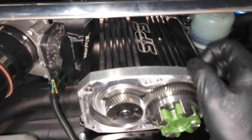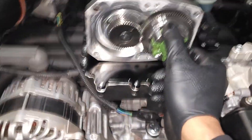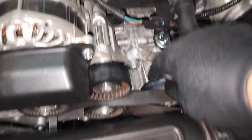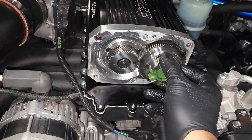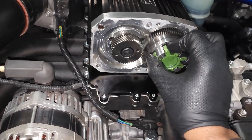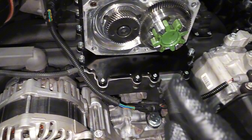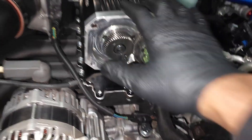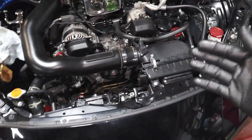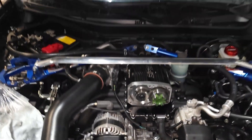Now we've got the rotor holding in — a very nice snug fit. The rotors are in there. This is the drive: your belt, which is here, is going to drive that pulley, which is going to key in here to the supercharger — the primary drive. This is going to spin with the engine at 7,000 RPM. And then whatever the pulley overdrive works out to — it's smaller, so we know it's going to spin faster. Judging by the size of that pulley, probably about four times faster. So for every one rotation of the crank, this is going to spin four times. The supercharger will outflow the air the engine can ingest, and you will have positive pressure until the airflow of the engine matches up with the airflow of the supercharger.